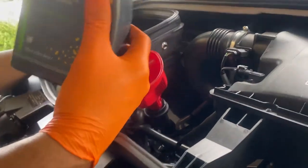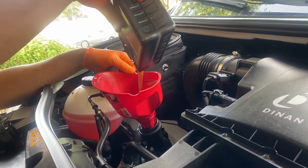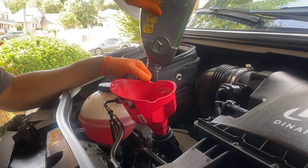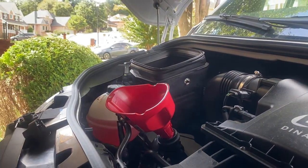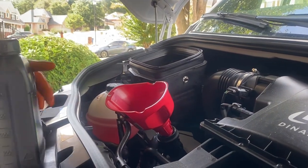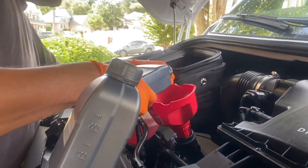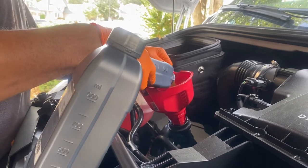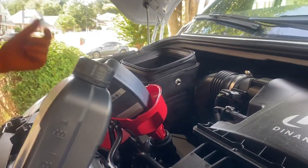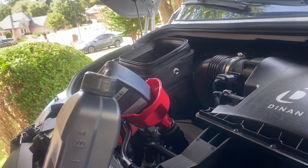When using a full bottle plus a half bottle, make sure you do the half first so you don't wind up throwing a full 13 liters in there. Do the half first, set it aside, and then do the rest so you don't overfill. Once the oil is back in, go inside the van, turn the ignition to the second position twice and then turn it off, do it again, then crank it up. And that's it - that's how you do your oil change on your 2019 Sprinter van. Good luck and see you soon.